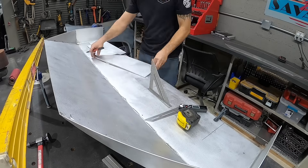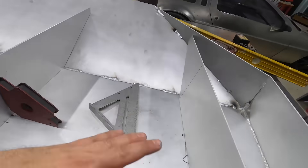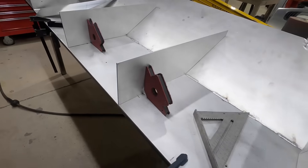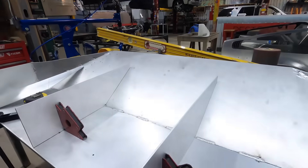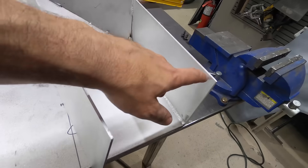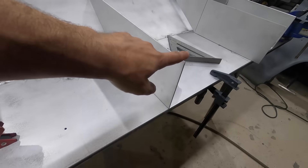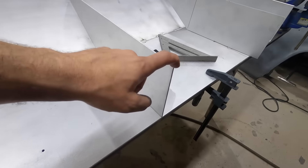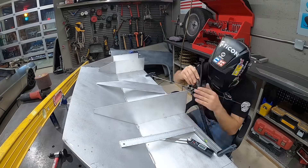After hours of blending, this diffuser is almost ready to get stuck together. I was hitting this thing with 120 grit DA for a while just trying to get the finish all even and looking good. This also needs to be scuffed up so the carbon will stick to it - we are going to do overlaid carbon on this diffuser. Now I get to weld these vertical slats in place. I'm going to put a little two-inch radius on the back side of these tips, rounding them off as opposed to a sharp edge. Once I get those radiuses where I want them, I'll weld them up and call it a day.